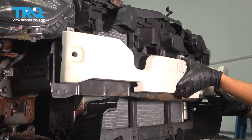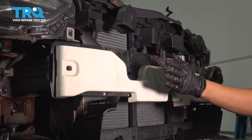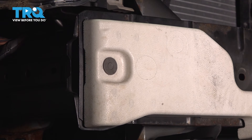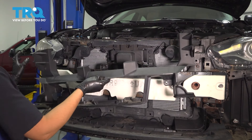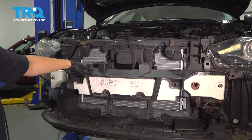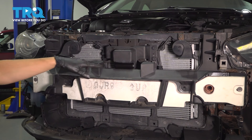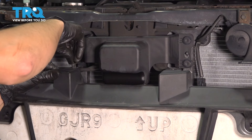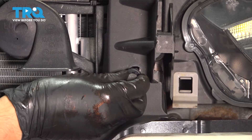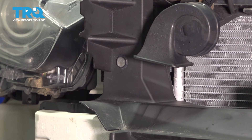Let's reinstall the bolt and install this styrofoam piece. Make sure it lines up everywhere and press it on — it had one push clip on each end. Stick that through, and once it's through, press the pin to lock it in. Do the same on the other side. Let's get this large plastic piece installed here. Line it up — I'm going to start clipping it onto the two lower clips first here, which are not push clips, they're just little tabs. That'll hold it in place, and now put in the four push clips — there are two in the middle here. Lock them down. If any of them are broken, replace them so that things can be secured in place properly. And one on each side. That's secured.